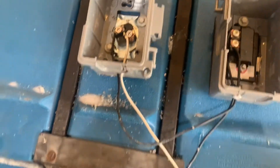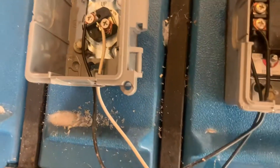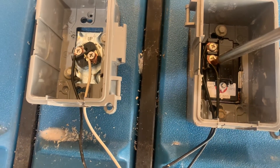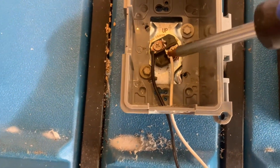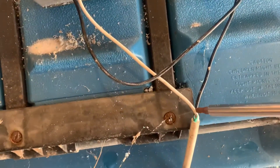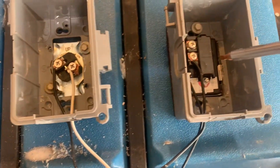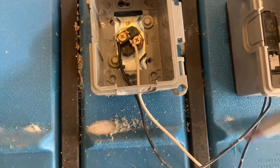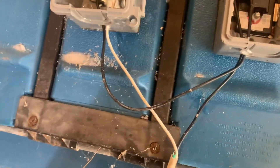Here's where we're at: main power comes in on black — I use black as the hot. That black wire goes into the top screw — power in, power out. I run a single black wire out; it does not matter which wire you put where. I come out with a black and white to the screw, then another black wire runs a single strand from the bottom to the other side of the element. Pretty simple. This cord is probably 25 feet — making good use of something that would have been junked.